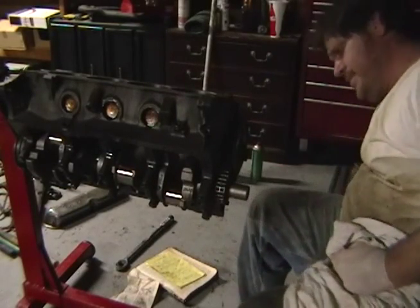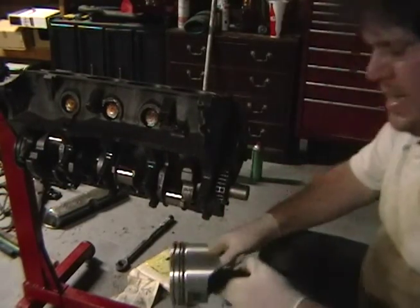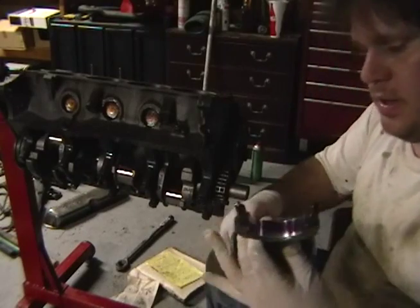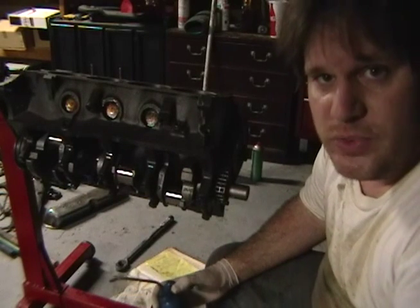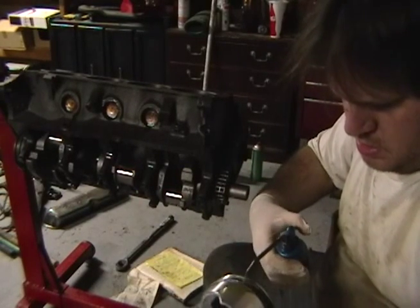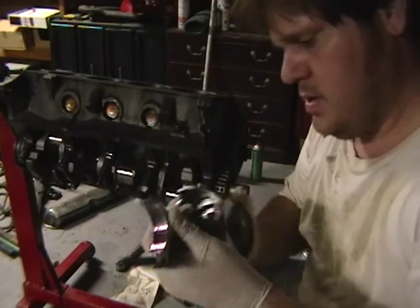Okay, that's number one cylinder and I've got piston number one. According to what I've read, you don't want to use synthetic oil on this part - it's too slippery and it's not going to work out too well. Only use assembly lube for the bearings themselves, but for the piston sides just use a good old 10W30. Just a light coating - you don't need to get crazy, just coat the whole thing.